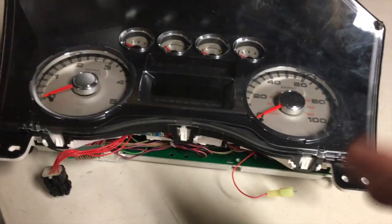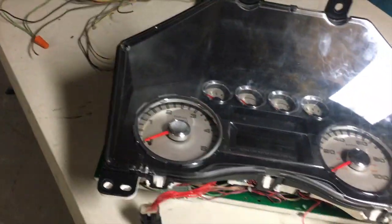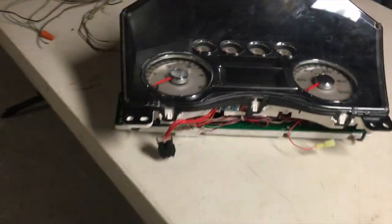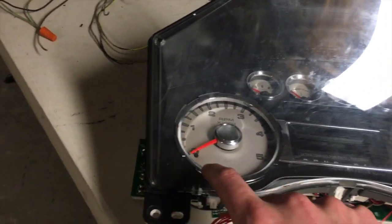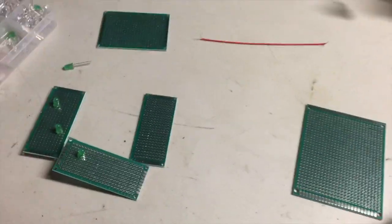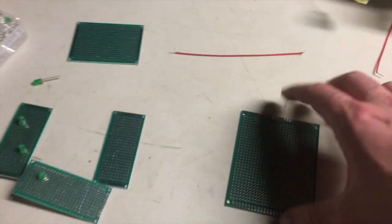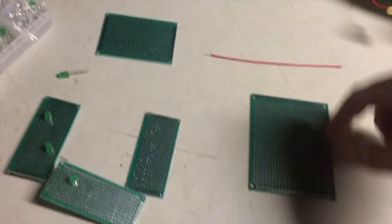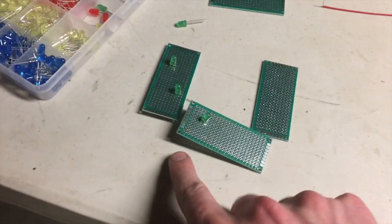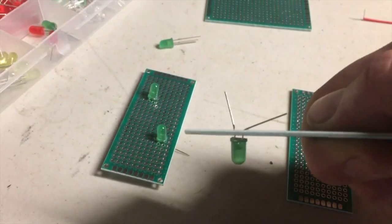You'll see these little circles in the plastic plate from the 08 — about a quarter-inch holes — and you want your LEDs to stick through there because that's where the original ones on the board are. You can see I've got an LED here, here's another one, here's another one — they work around the whole thing. When you mount your LEDs, you'll mount them to the PCB board. You can cut out the PCB board and leave a hole in the middle for the motor, or use rectangular PCB pieces and go around it like a rectangle so you have clearance in the middle for the motor.